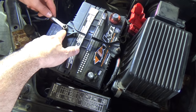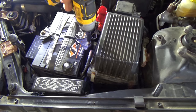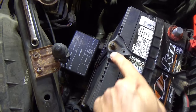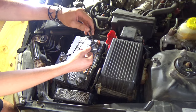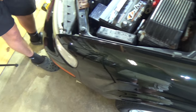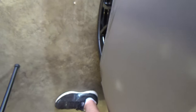Now we can get the strap here - the tie down. We want to get a deep 10 millimeter socket. Get it to the top. Now these have like hooks down in the bottom. Sometimes you have to take them all the way out - I just twisted it and got the back one out. Don't cross the terminals - don't touch this to that or we're going to have fireworks. Take all your stuff that you remove and keep it in a nice neat spot. The battery comes straight up and over without hitting any fenders. Put the battery off to the side out of our way.